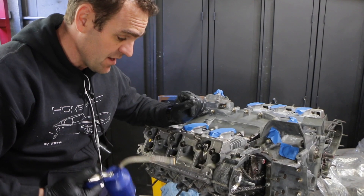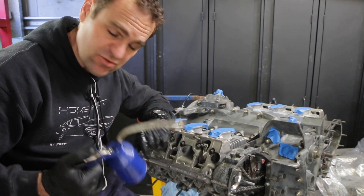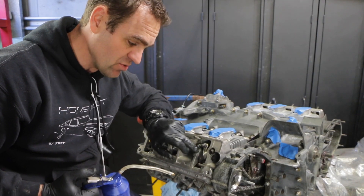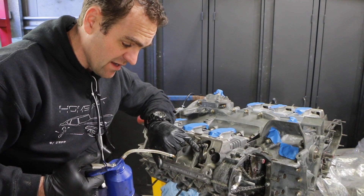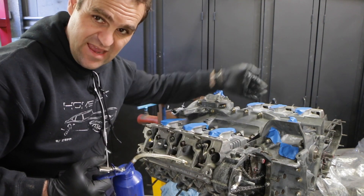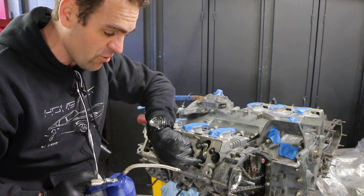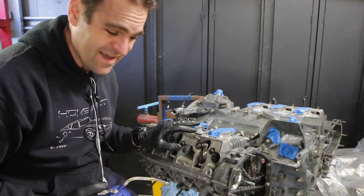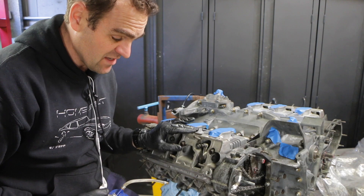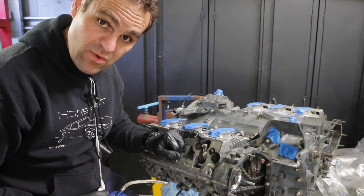That actually wasn't too difficult to put in dry. A quick note on installing this dry: I am still going to go through the oiling holes on either side and, as Mike suggested, actually put a few drops of oil each side on all of these rockers — just pre-oil them on both holes on both sides of the rocker. It should be all good once that's all soaked in. That's one in. I'm going to install three more and then we can move forward.